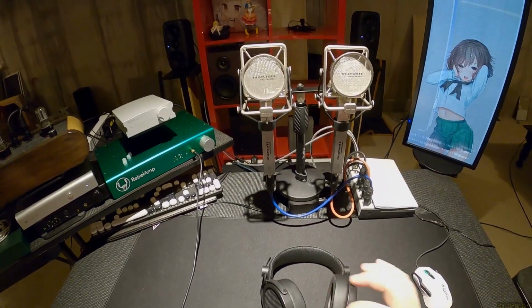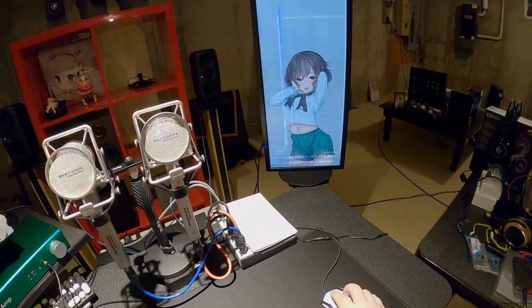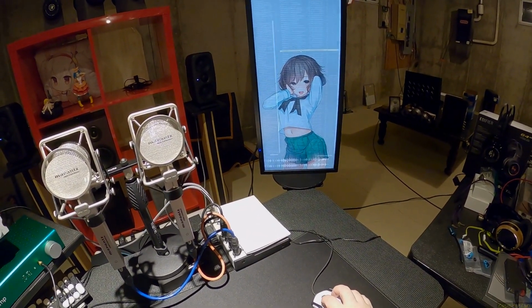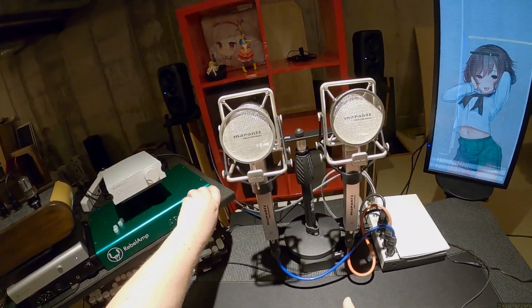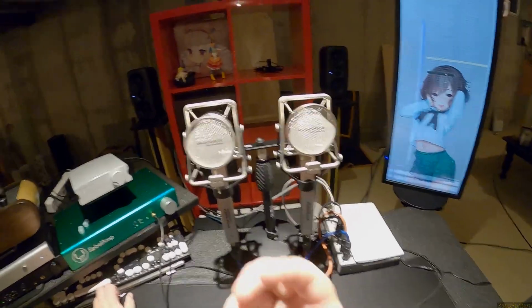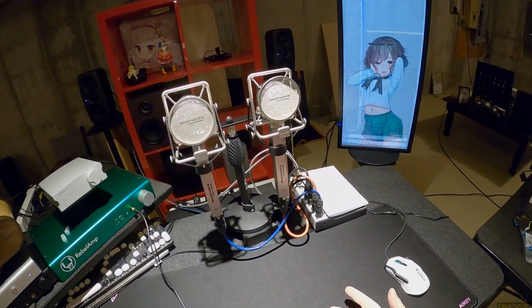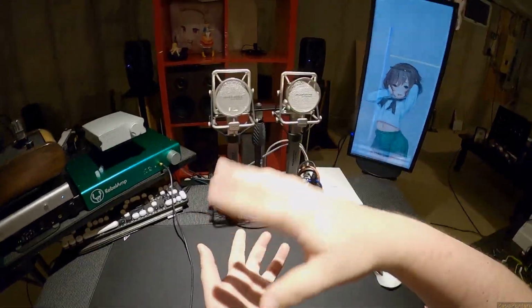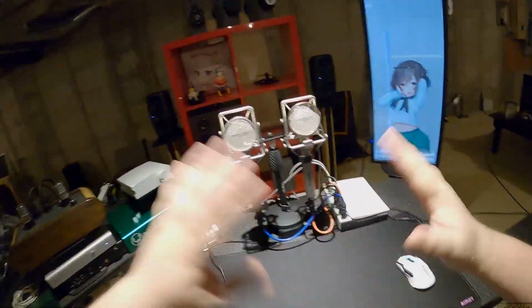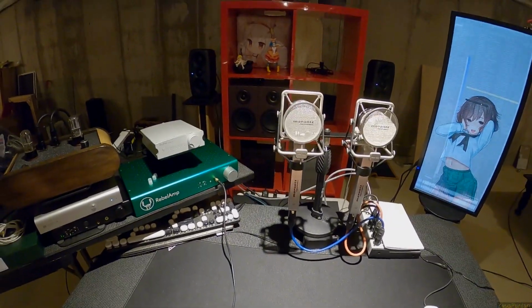It's more open. I got to put on a real bassy song. Give me a second. Luckily, I'm right where I need to be. Yeah, these do more low end by a large margin. They're physically open on both sides. It's like an open baffle speaker. If you've never heard an open baffle speaker, your car stereo is all open baffle. There's no box that holds the speaker in, that it can be compressed. They're just shooting into the trunk and into the doors. So imagine good bass on that, what that sounds like.